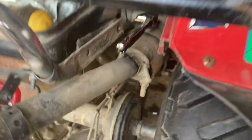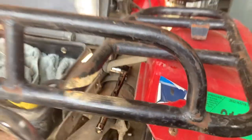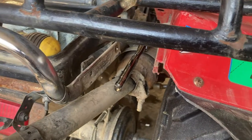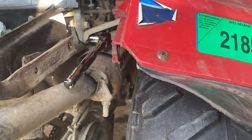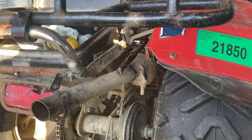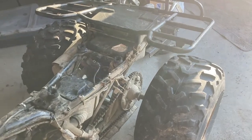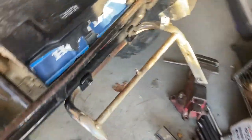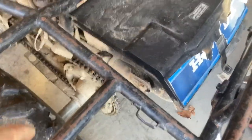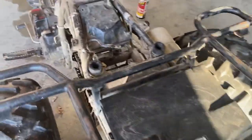Now that this has moved away a bit, we'll take this last bolt out that supports the fender. This gives more room to work than trying to take the rack off first. Taking this one off, we can pull the whole fender out. After doing the other side the same way, we're down to just the whole rack assembly. The bumper is now loose because we took the mounting bolt out and popped these off so the fender could come out.